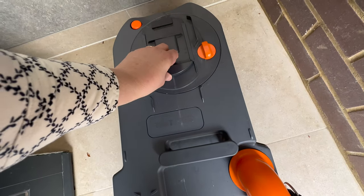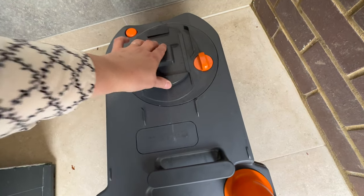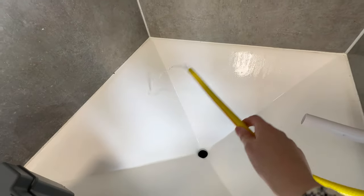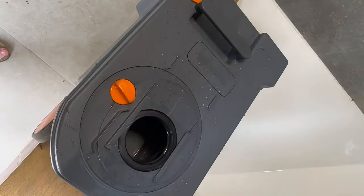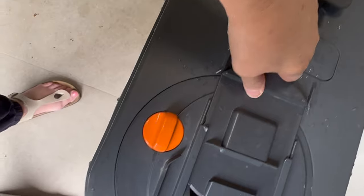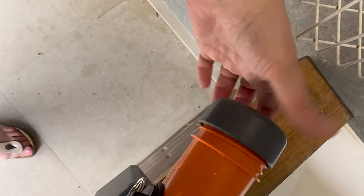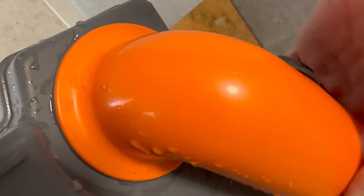When you've partly emptied it you can take your slider off and twist that, which opens it even more to check you've emptied it entirely. When you've emptied the first load and flushed, do rinse around the sides to wash down all the chemicals. Then add some water into your cassette. When you've done, close them up, put your slider back in, and replace your cap on the end. Slide it back into position.